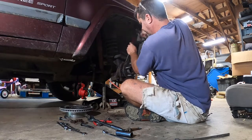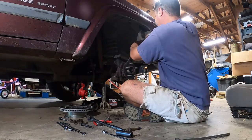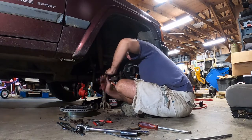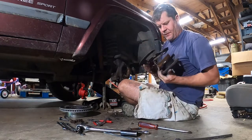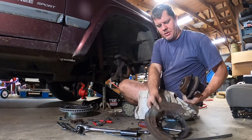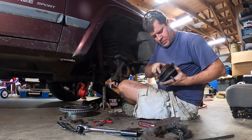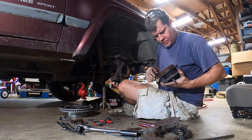It takes a little bit of persuasion with a chisel and some jacking bolts to remove the hub. You could clearly feel the play in the bearing, as well as hearing it grinding as you were spinning it.